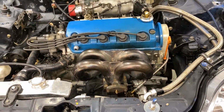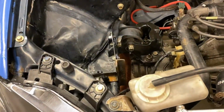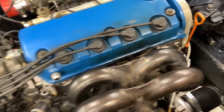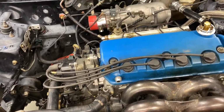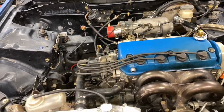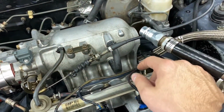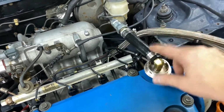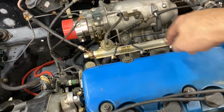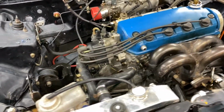But they got the engine put back in most of the way. I told them to leave this whole side off so that I could still wire. Looks like they did that for me. Thank you, boys. There's a couple of things that still need tied up with this thing, like the shifter's not hooked up yet because I have the Jesus clip for that, or the bitch pin, whatever you want to call it. And then I want to get some caps on this because that does not look very professional. And then I am going to get this fixed as well with that valve cover that is sitting right there. That'll have two ANs off the back up in the baffle plate, and we'll get more flow out of the crankcase, which can only make the engine last longer.